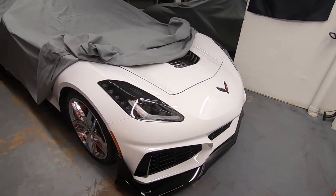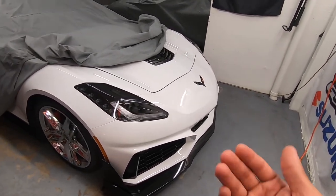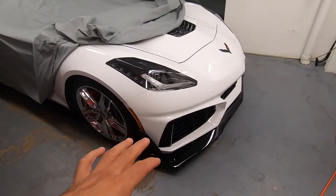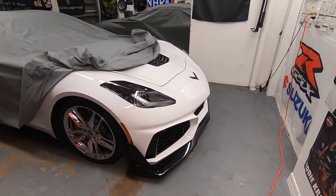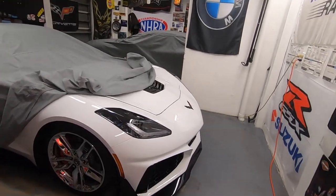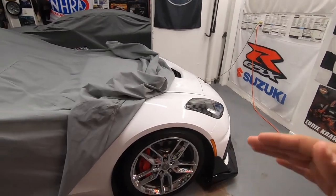You also have to get different screws because the factory bumper screws are too tall and too long — you either have to cut or modify them so they don't poke through the lower valances. Everything must be secured, because at 50 to 60 miles an hour the amount of air this front end grabs will rip off fender liners, brake ducts, and everything else. If your stuff is not tip-top underneath, don't even plan on doing it.